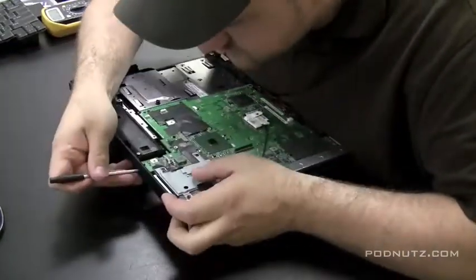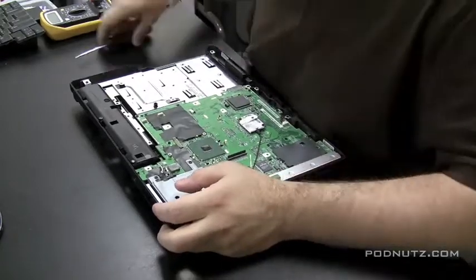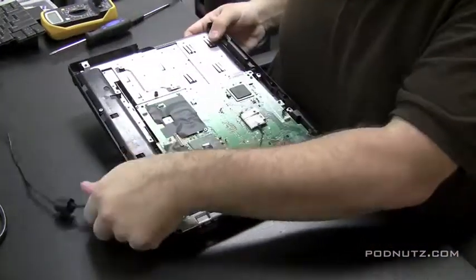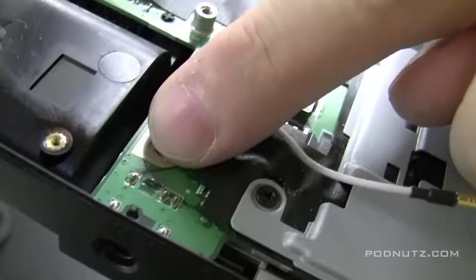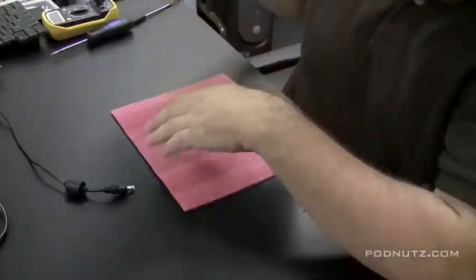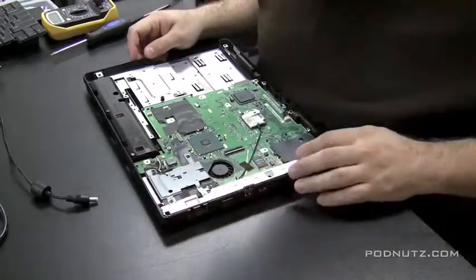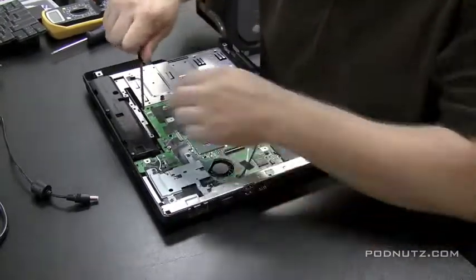I'm putting a screwdriver into the power jack hole to shake the pin around. The pin inside may be loosely attached to the motherboard — that's why there's no connection. The power adapter cord isn't plugged into the wall right now, so it has no power. You can see that center pin is pointing in a different direction and is loose from the motherboard, so we're going to have to re-solder it. When we jiggle the power adapter you can see that pin move up and down.